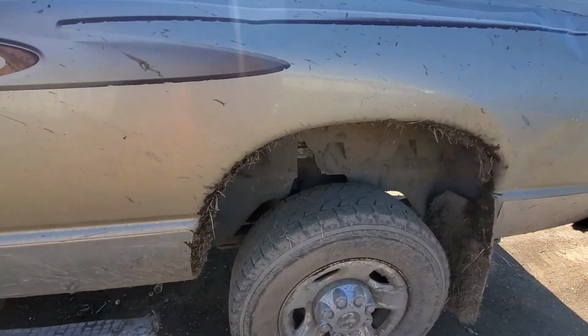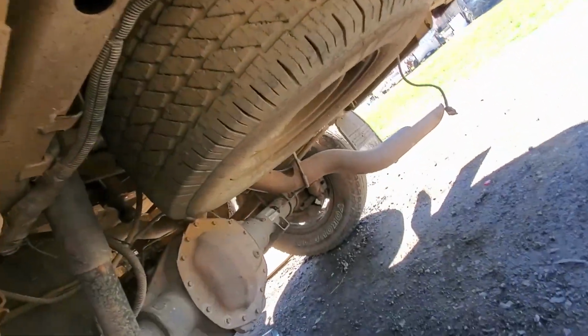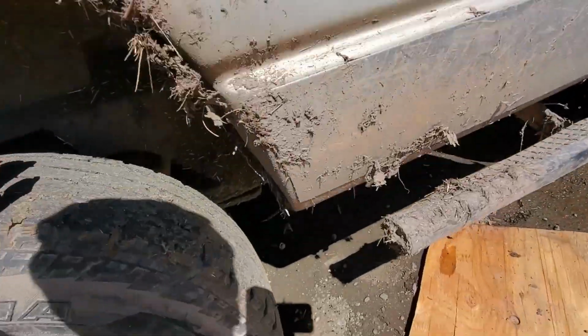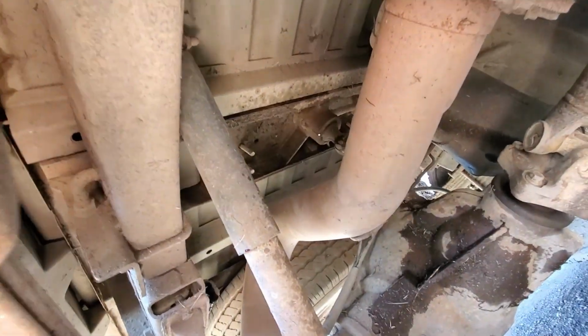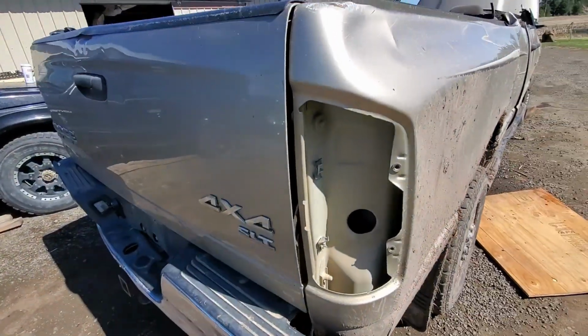And then on a long bed, there's 8 bolts, 4 on each side. Basically, 1 over there, 2, I already pulled them. And then in the back, 3 over here, and then 4 over here. Since this specific truck has a gooseneck hitch, I had to pull the safety chain U-bolts out. That was four nuts. You can't really see here. Basically over there, those U-bolts that are hanging down. And on this side, 4 bolts on the bed. And pulled some electricals out of the lights. They should be good.